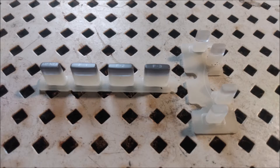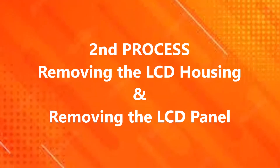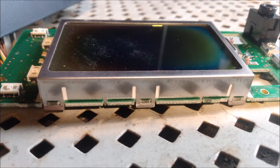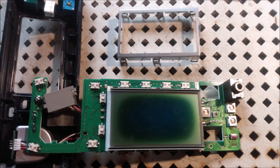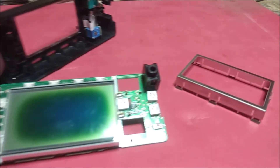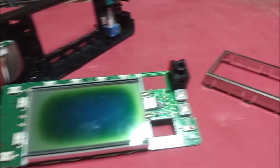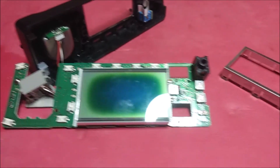The second process is removing the LCD housing and the LCD panel. This is a very technical part of the repair — it involves removing the metal frame on its connections, there are six of them. Do this very carefully without over-bending them. Once you remove the metal frame you have the LCD panel behind it, and this is when you have to be very careful. Make sure to mark and make notations on where every component is and goes.